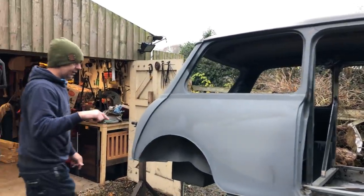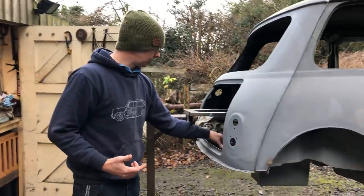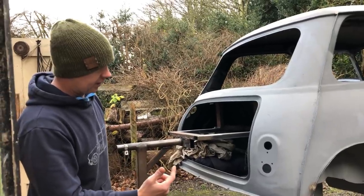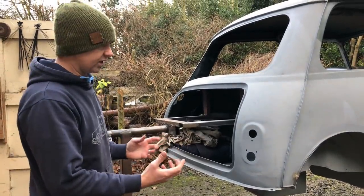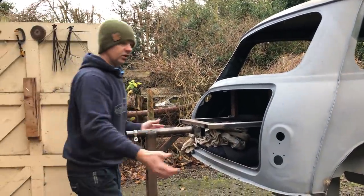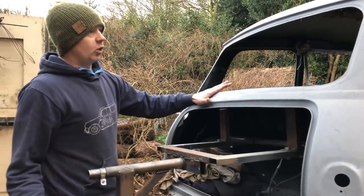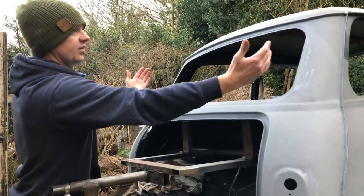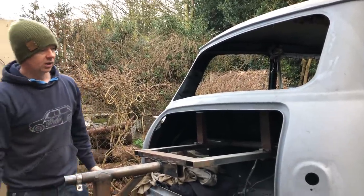Coming around the back, the next bit we did was the boot floor - there was a big repair panel in the boot floor inside which we replaced. The strengthening plates for the subframe all had to be welded in and jigged up to make sure they were right. The heel panel or heel board was also replaced. Then we did the smaller back lights for the Mark One - just one of the telltale signs - so there were infill panels and the back window aperture is now narrower than it was, which is what it should be on a Mark One.